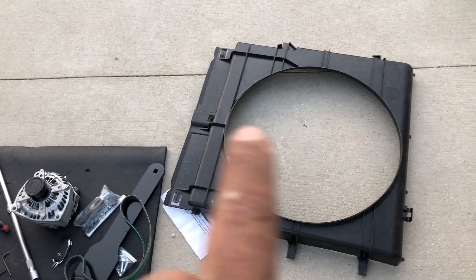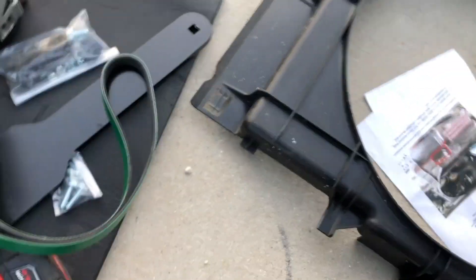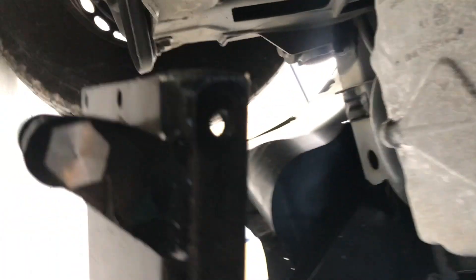That fan shroud still needs to be nudged out right there according to the big picture. This is the new pulley — super large for full alternator speed even off idle. That's going to go on like this. This bracket here is going to go there, and off of the front those two threaded holes take a plate that goes in front of it where the tensioner sits.